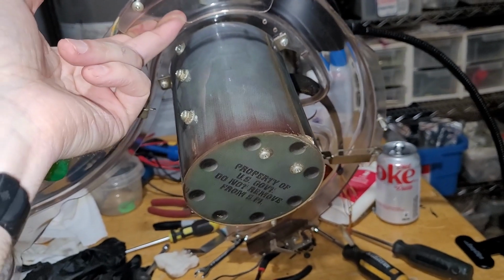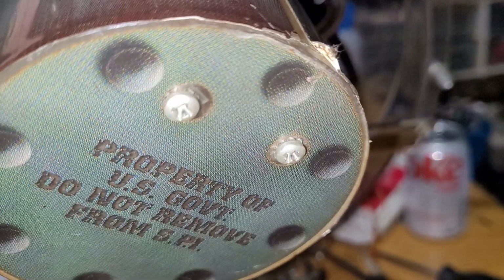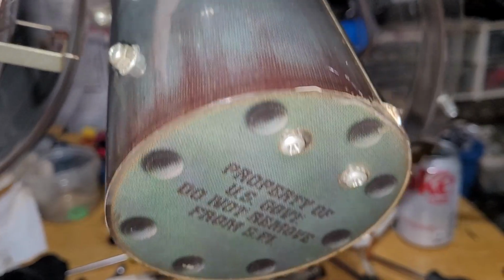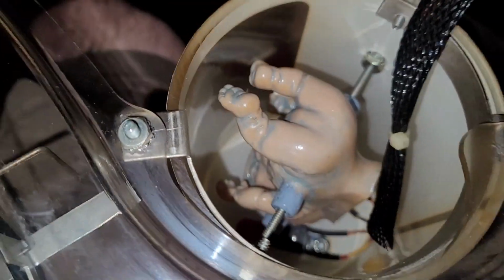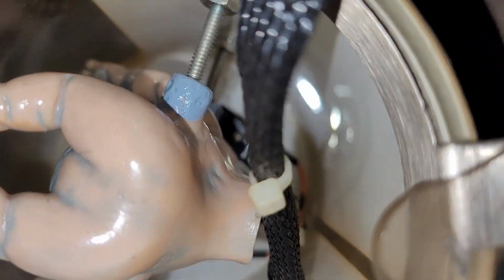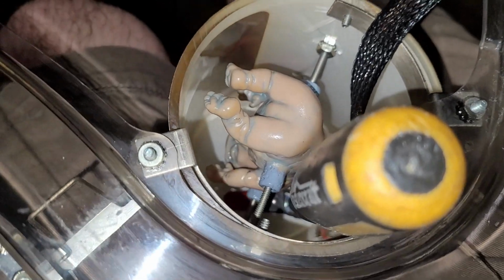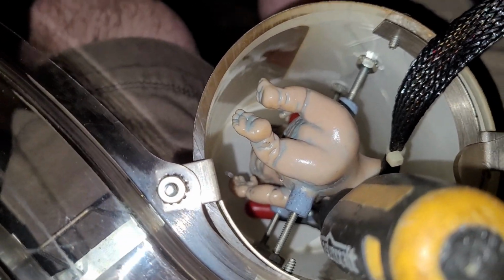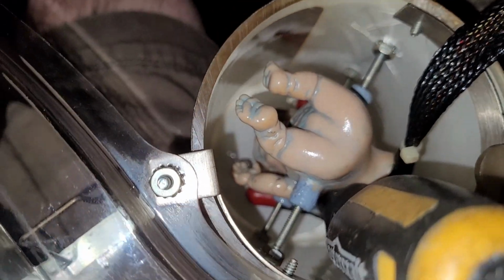Okay, so this is the little housing for the baby alien. And if you want to change the light bulbs, it's just as easy as removing these 2 screws, right? Wrong. You need to remove the entire ramp, turn it upside down, inspect alien baby's bum, change his diapers while you're at it, then get a nut driver all the way down onto the nut on each bulb, and then get your screwdriver on the other side. So you can imagine why none of these bulbs would ever get replaced from just a generic operator back in the arcade. Not very accessible at all, very bad design, but that is what I'm doing now.